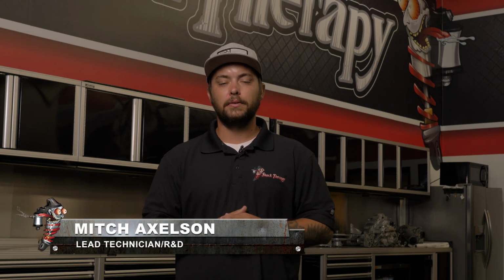Today we're going to show you how to install the rear toe link kit on the Polaris RZR Pro R and Polaris RZR Turbo R. This toe link kit's going to do multiple different things for you guys. The most important one is it does get rid of the eccentric bolt design that comes from the factory on these cars. Our kit is left and right hand thread, so similar to the front tie rod design, you can actually adjust your toe in or out to set it to the perfect toe measurement that you're looking for.